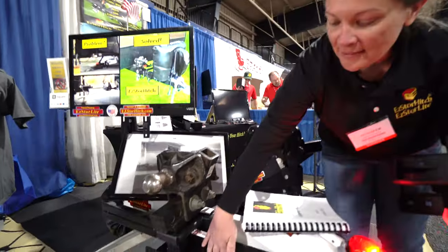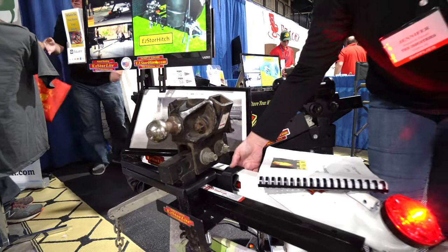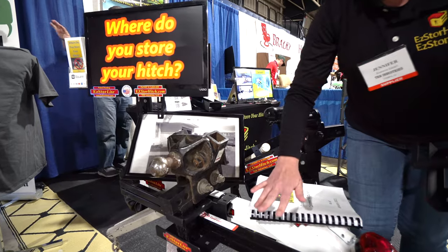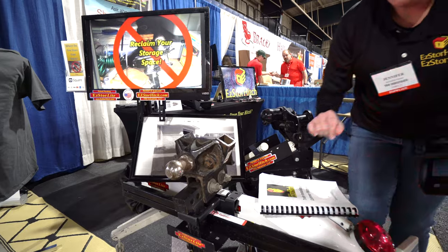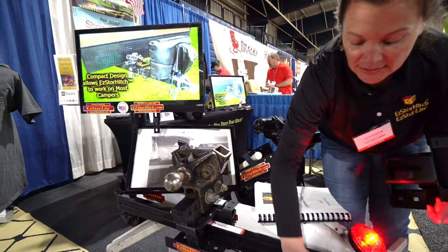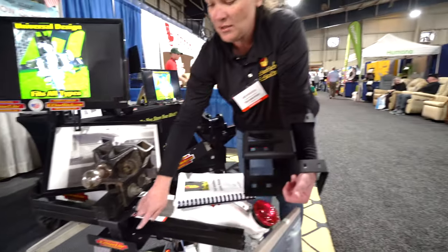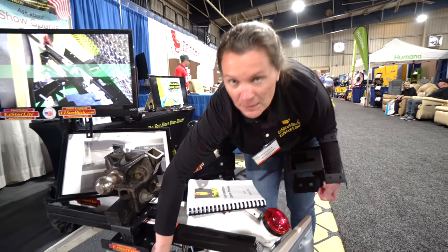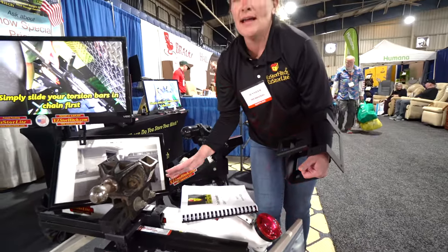You can see the bars stacked on top and the hitch dropped in — it's literally just sitting over the A-frame itself. Because this doesn't have the security features of the full version, one thing we thought of is using a cable lock. You can go through your sway bars with the cable up around the A-frame. We've created extra holes so you can bring the cable lock through and lock it all into place. You still use your hitch pin to lock your hitch underneath it, so you've got some security on that as well.